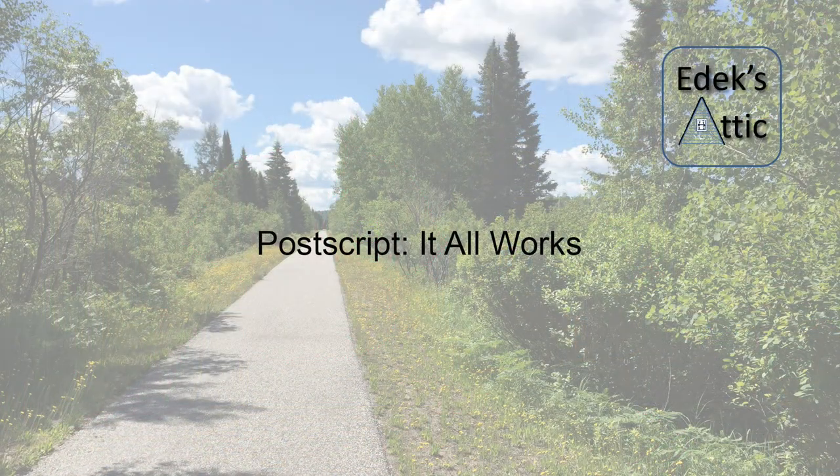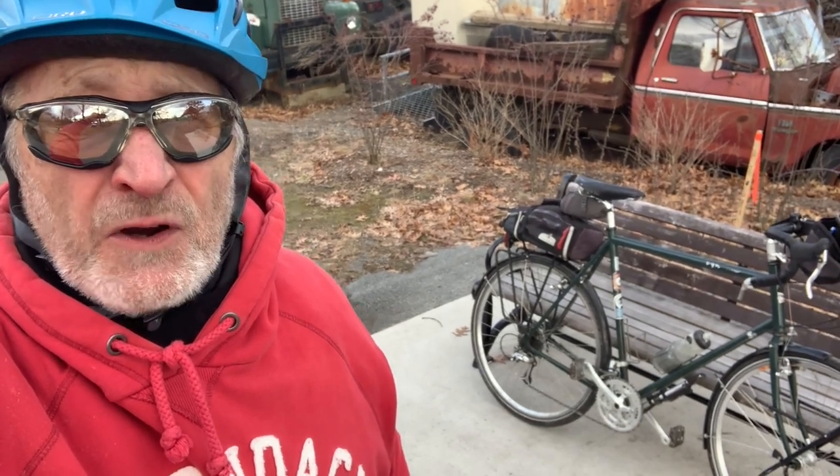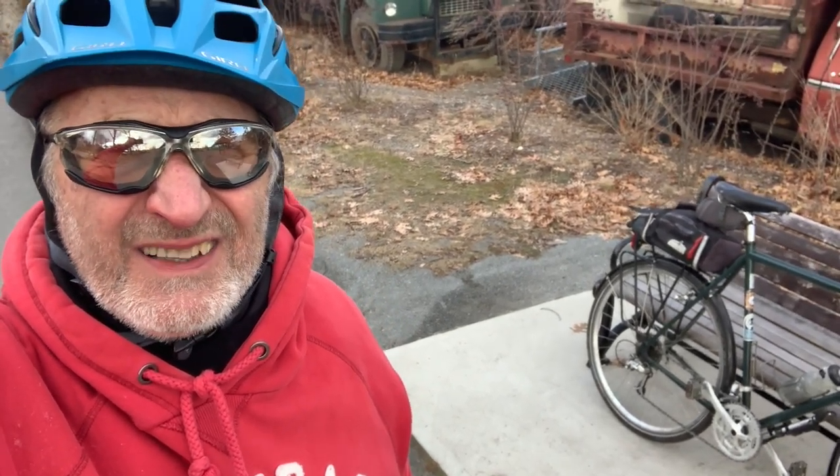Now I have everything reassembled and I'm ready to take a test drive. I'm out for my January test ride for the crankset, chain, and bottom bracket, and the drivetrain feels a lot smoother. I did bring a wrench, because it's recommended that after you install a crankset, after the first 10 or 12 miles, you give it a little tighten-up — it will come a little bit loose. I was glad I brought a wrench.